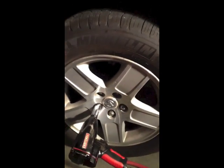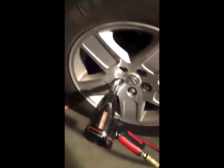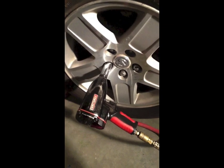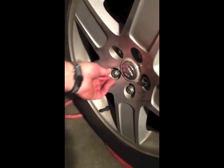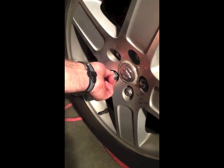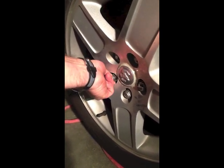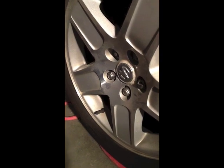Notice it's turning — but what's happening is it's actually the aluminum that is turning around the outside of the bolt. This is a bolt we were just working on. See that right there? I can literally turn the outside skin of that bolt, but the inside skin of that bolt is not turning at all, because it has been over-tightened and ruined.